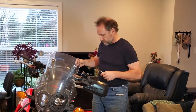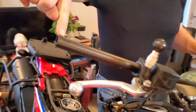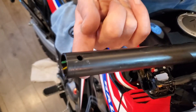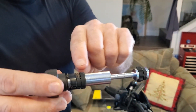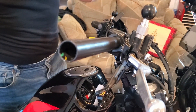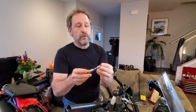Come on over here and I'll show you. On the right hand side there's a hole up here in the handlebar at the top and another one at the bottom. On this piece there are two tabs — one on the top and one on the bottom. You squeeze those two tabs in and the whole assembly slides right out. This little rubber bit will usually come off when you do it, so you've got to fish into the handlebar and pull it out. No big deal — you can take all of that and just chuck it. You won't need it.